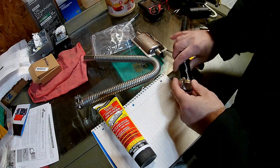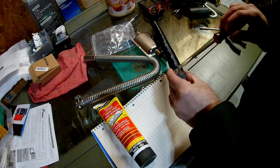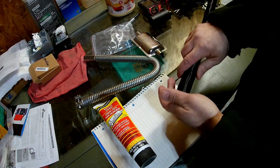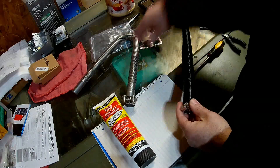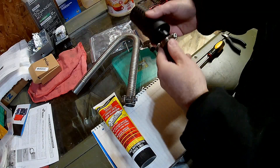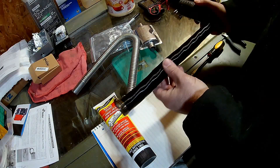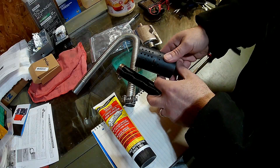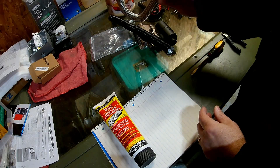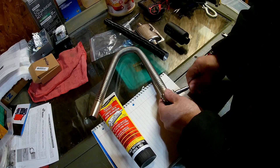As you can see, there are a couple of small holes on this muffler — it's not airtight, so you don't want it inside your workspace. For the air intake, I used one of the round clamps. It's not as critical that it's perfectly airtight here since you're sucking in combustion air. This intake cover isn't really a filter — it just keeps larger debris out of the pipe. The holes are fairly large, so a bug could potentially get in, which could gum things up inside.